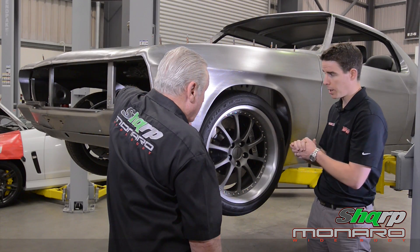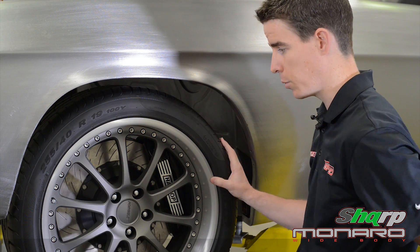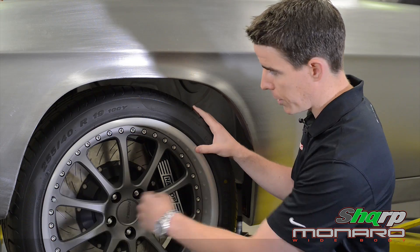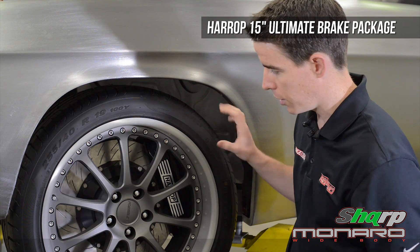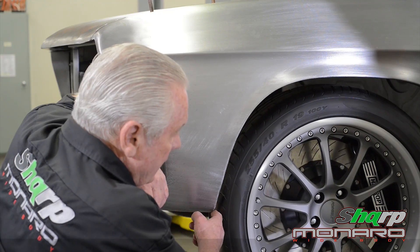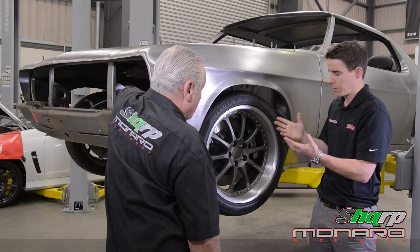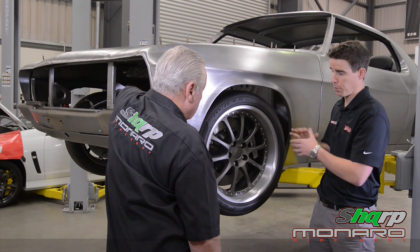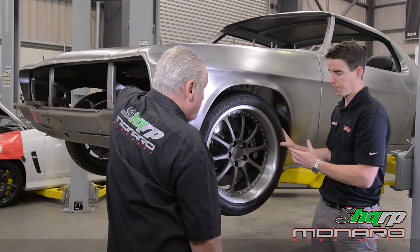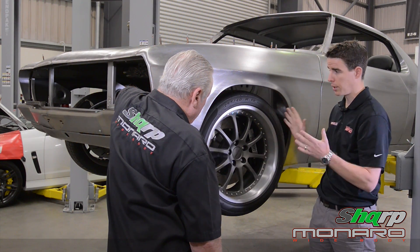We would take the measurements in exactly the same way, but pay particular attention to the way the wheel has to move to make sure the inner wheel's not going to foul anywhere on the bodywork. This wheel's a little bit narrower, still a 19-inch, running the Pirelli tyre. We've managed to fit our big 15-inch ultimate brake package underneath this 19-inch wheel, so it's got all the stopping power needed to support the high horsepower motor. Clearances on bodywork have got to be taken into account for the outer diameter — it's important to get it millimetre perfect. Forgeline have an algorithm and a program that will actually design the wheel, and then once we bolt it on it's right to go. We make sure clearances to front and rear guards are all accounted for.